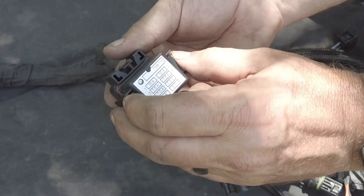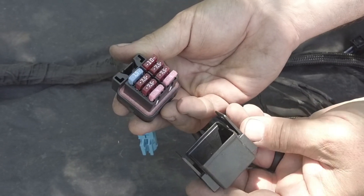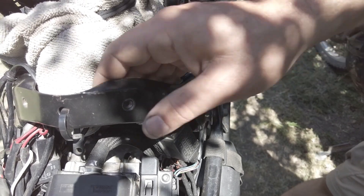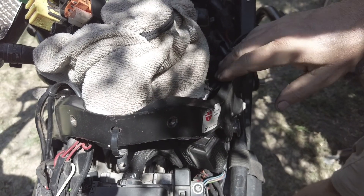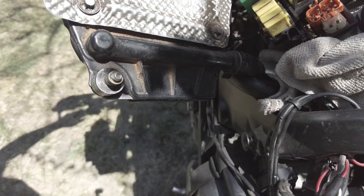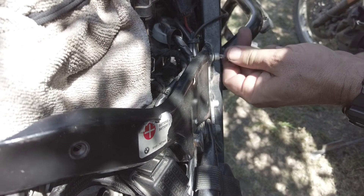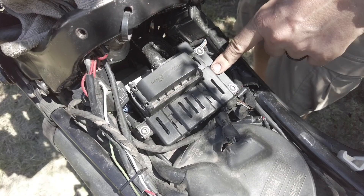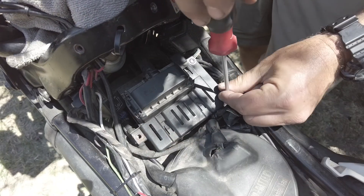Check out the new fuse box — it even comes with brand-new fuses, and we have spares. To make things a lot easier, it's best to remove this brace — I don't think you can even pull the harness without removing it. There are four little Torx bolts that connect the brace; we'll remove those. We'll also remove the three Torx bolts that hold down the ABS computer.